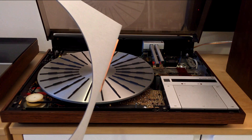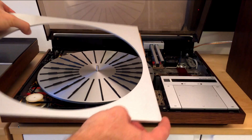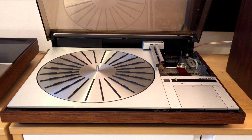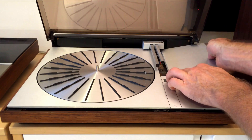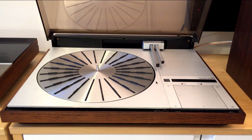Now we can put the aluminum plates back in. The important part here is to make sure that the copper tab is facing the small plate that goes in here — it should just seat in place. If it doesn't, pull the plinth forward all the way and then it falls down. After the large plate is in, we can put in the small one. Note this fork-like copper tab — it is supposed to mate with one of those protrusions on the bottom side of the panel. The fork needs to catch this to guide the panel into place. I put it on the fork and make sure this edge is going above the copper tab that's on the larger plate.